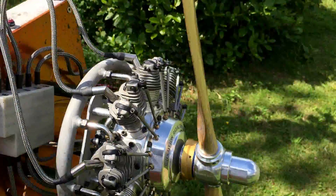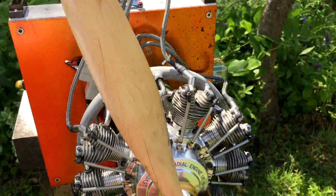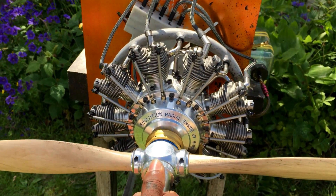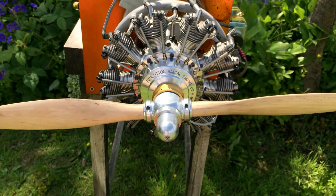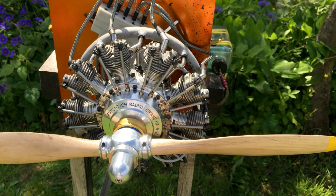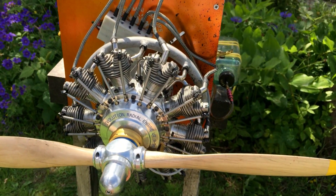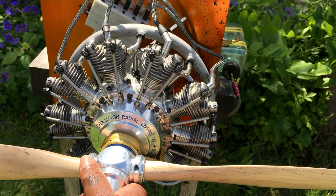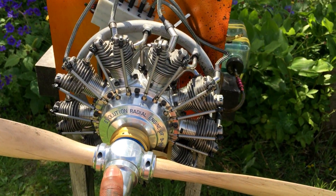There you go — transitions really well. As I said, the top RPM I'm seeing is around 5,500, and it idles happily around 1,000. There will be links in the description of this video where you can find all the parts for your conversion for your 9-cylinder radial.